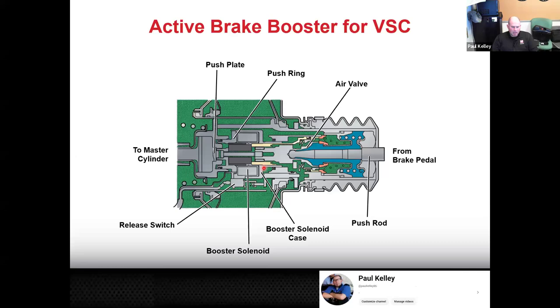The second we want to get into, let's say, a vehicle with pre-collision, or any car that's going to apply the brakes on its own, whether to avoid pedestrians or, if you're backing out of the driveway and it senses an object and applies the brakes itself, it's all some version of collision avoidance. We're going to abandon these. And I think that's more where Kenny was going when he asked that question. Yes, cars still use these, but fewer and fewer because it's more and more difficult to build up a lot of brake pressure without a person stepping on the pedal.